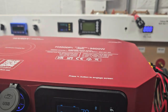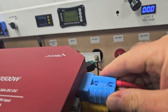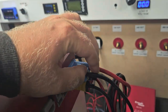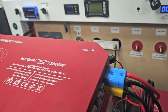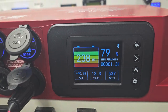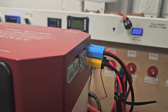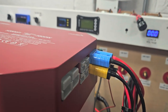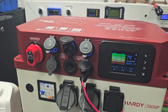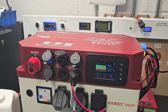What we can also add to that is the 30 amp 12 volt feed straight off the start battery. You don't need any current limiting device — that can just go straight onto the 12 volt start battery. The 30 amp DC-DC charger is built into the box. So we've got up to 40 plus amps now — that's a combination of both the 30 amp onboard DC-DC charger and 200 watts of solar panel running, partly powering the fridge, and the rest charging up the battery.